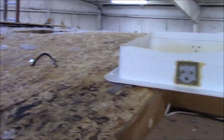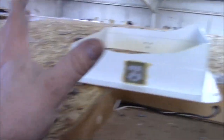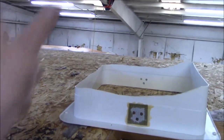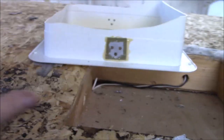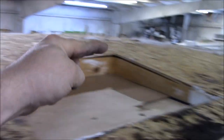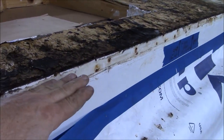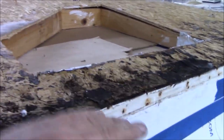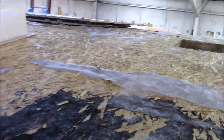With all that moisture getting shot in here — it could be a combination of things. Anyhow, we're going to rip all this decking up. I've never seen anything like that. I have seen in a house, in the bathroom, you have a vent that comes up — a fart fan basically — but it also draws moisture when you get in the shower and sends it outside. I did see one where somebody brought it up into the attic all the way down to where the gutter was, the fascia board, because it had a soffit vent on the bottom side. They figured all that hot air would just get vented out — well, it never did. It rotted 28 feet of fascia board off that thing, the gutter fell off, and the rafter tails were rotted. It needs to go out through the roof. That's the way it's designed.